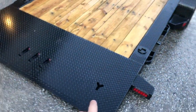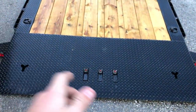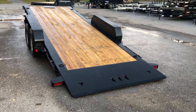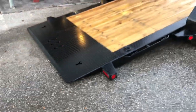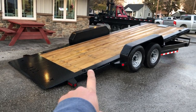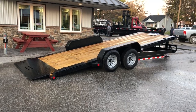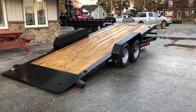There are banjo eyes for additional tie-downs — you can use chain on those. This is also a full knife edge with no center slot, so you get full-width loading all the way through. There are marker lights in the center and stop/turn/tail lights on the outside. The trailer loads at roughly an 11-degree load angle, which is very smooth. With only one break in the plane — knife edge down to virtually zero transition — and without a second break like a traditional beaver tail trailer, you can actually load lower equipment. That second break in plane normally equates to about two degrees, so an 11-degree angle on this loads almost like a traditional car hauler at a nine-degree angle. Pretty low equipment friendly on this unit.